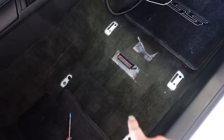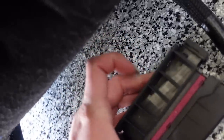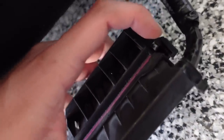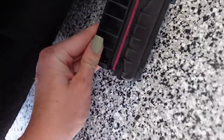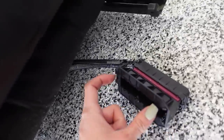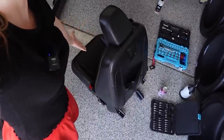That's how crazy I am about detailing. This piece right here — if you're wondering where I put my flathead screwdriver — will be sitting inside underneath the seat. You'll see this piece connected with another piece that goes in here, and you just shove your flathead into that little hole and then the whole thing slides sideways outwards so you can unhook it. So it's just the two bolts and the little pop of the flathead, and boom, your entire seat is out.